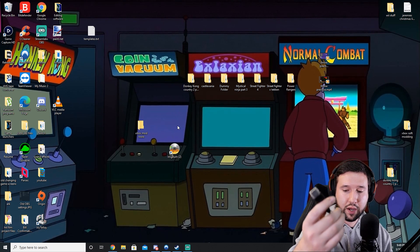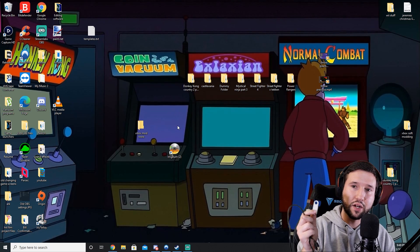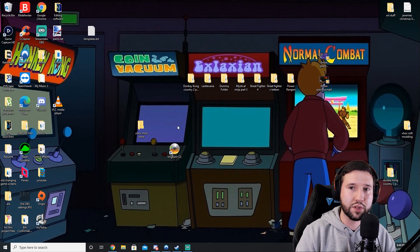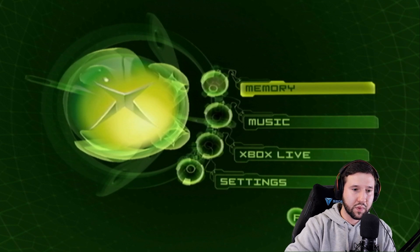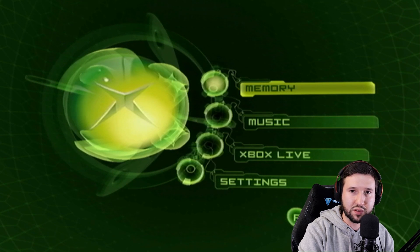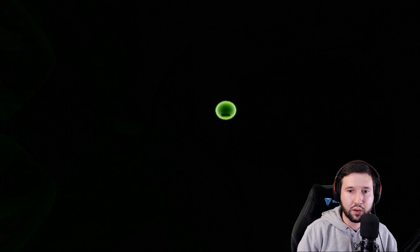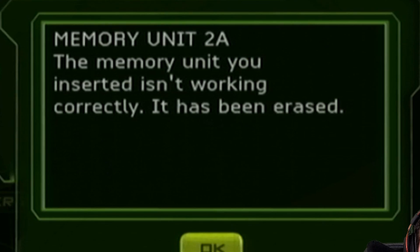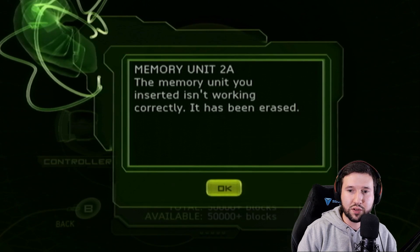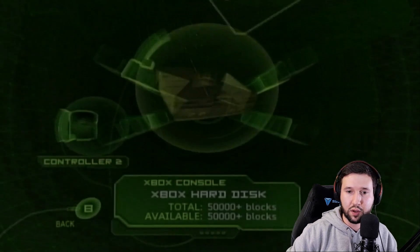Take your female USB cable, plug that into your Xbox, and then attach your flash drive to it. Now that you've got that connected, what this is going to do is format the USB flash drive — you want to make sure the Xbox does this. Once you have that all connected, go ahead and select memory. You're going to get a message that says the memory unit you inserted isn't working correctly and has been erased. That's fine — that's exactly what you want. It has already formatted it to whatever the Xbox needs. Just hit OK.